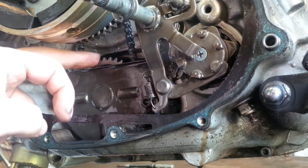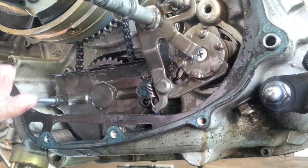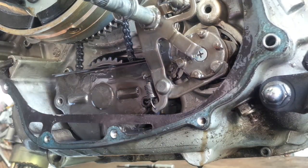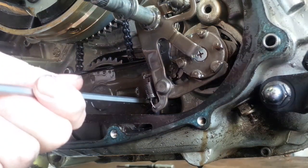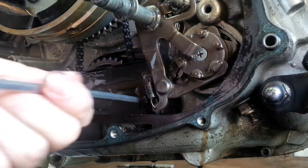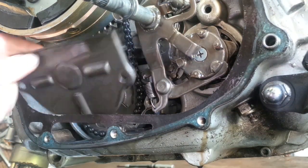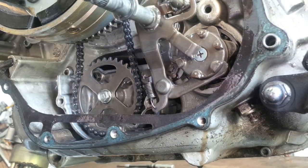So — tiny chain, sprocket, and the cover over the whole thing. We are going to start with the cover. It has two allen bolts, six millimetre, and it comes off with a five millimetre allen key, so the thread is M6. They are fairly small, and here comes the cover — it's just a sheet metal cover, nothing fancy.